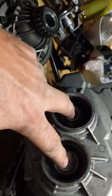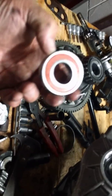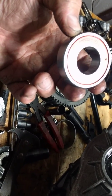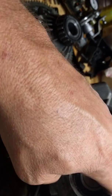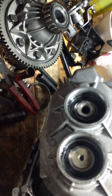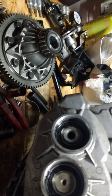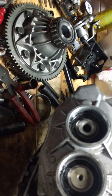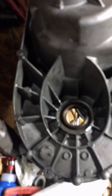At the bottom of the shaft — both shafts, since it's a two-shaft transmission — you have sealed bearings. Here's the replacement: it's an NSK bearing number TM205, the exact same bearing number as the one already in there. The replacement comes in a $109 kit from eBay from a shop called something like the Gearbox Shop, and it comes with original Mini seals and everything. It actually turned out to be a decent kit.